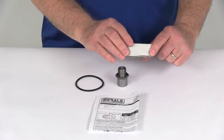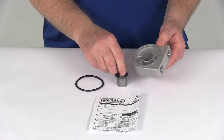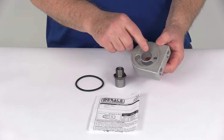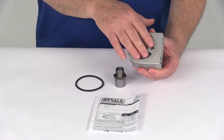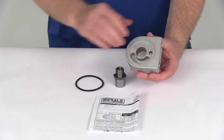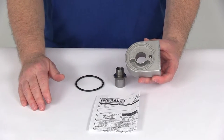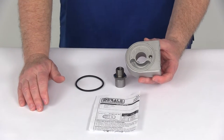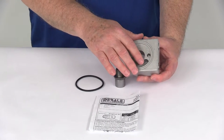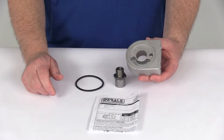This sandwich adapter is cast from high quality aluminum and it does maintain the factory equivalent oil filter. There's a built-in relief valve — this allows the oil to bypass the filter when the pressure gets too high. Basically, when your oil is cold it's pretty thick, so when it starts to go through the engine the pressure gets higher, and that relief valve will open and allow that oil to bypass to keep the pressure from getting too high.